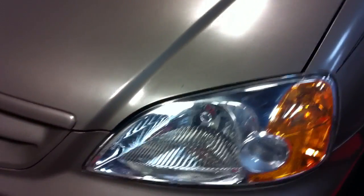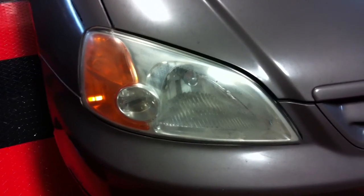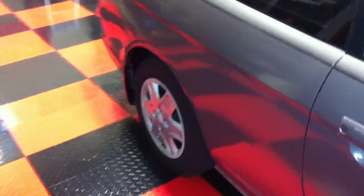It's extremely oxidized. I did do a little test to the B-pillar and what I found out is this is actually single stage paint. Now after it was wrecked they replaced the headlight that broke, but they didn't replace the headlight that wasn't broken, and so over time it's faded and turned yellow — we'll fix that tonight too. This is single stage, it is incredibly dull and oxidized, and our job is to try to restore the gloss and clarity and get that finish all smoothed up so it'll resist deterioration better in the future.